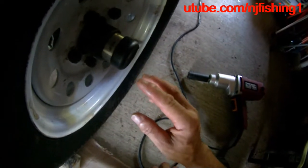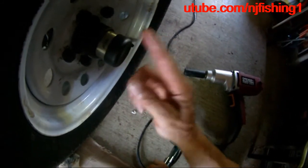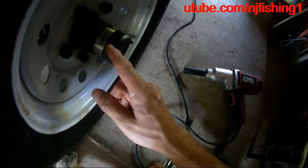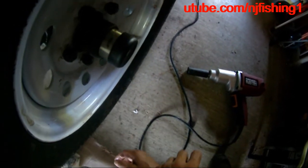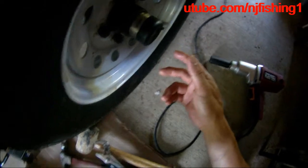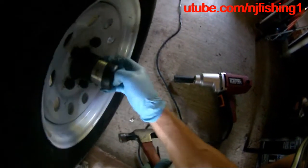It's important to do this repeated five times. When I put it back on, I did not do that — I just tightened it with the channel lock and backed it off one castle nut slot, then inserted the cotter pin until I found the opening. So I have to redo it, and that's why I'm filming this — so you know how tight a castle nut should be.